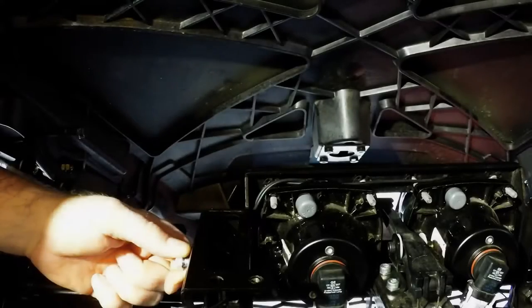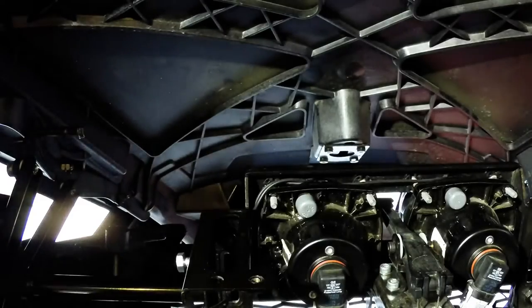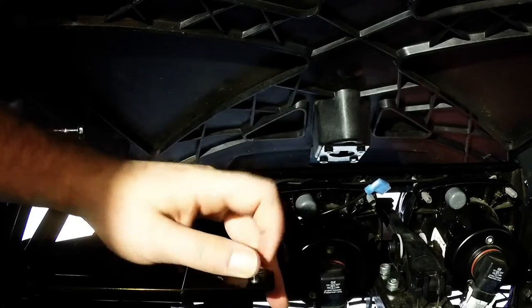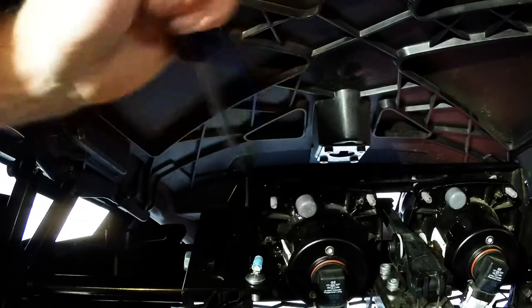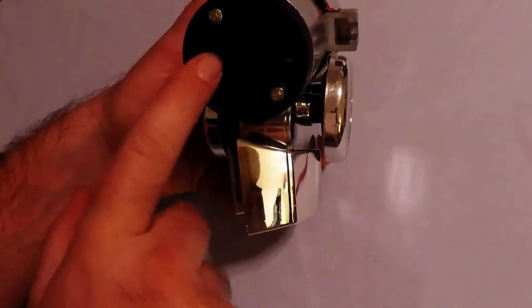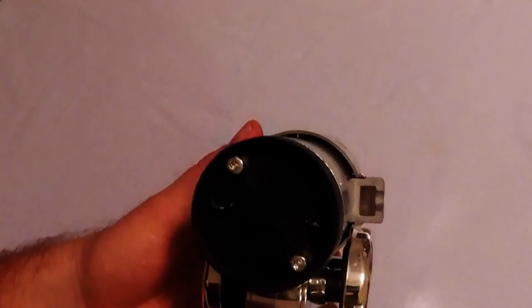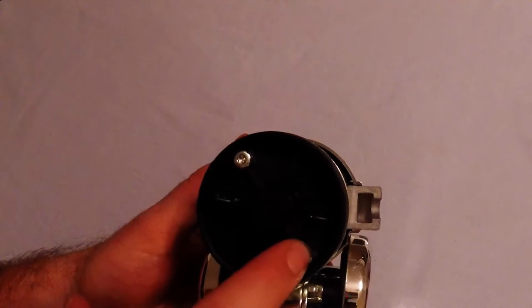This is the mounting bolt we just installed. Above that, you'll see a threaded hole — it'll have a bolt in it if you have the stock airbox. Take the ring terminal end of your ground wire and install it here. Once you've installed the wire, be sure to route it through the light support. If you turn the horn upside down, you'll see two terminals — positive and negative. You can tell the difference by the little symbol next to each terminal: a plus for positive and a minus for negative.